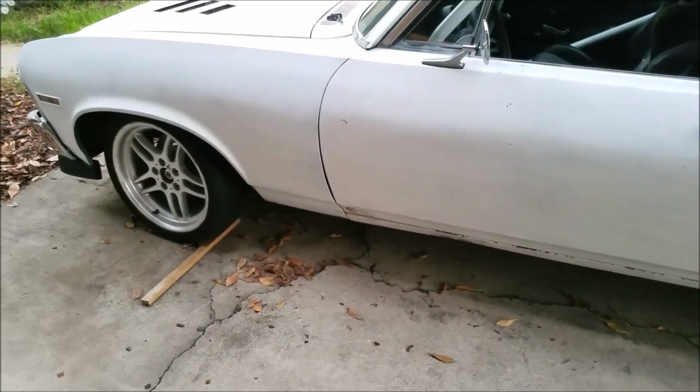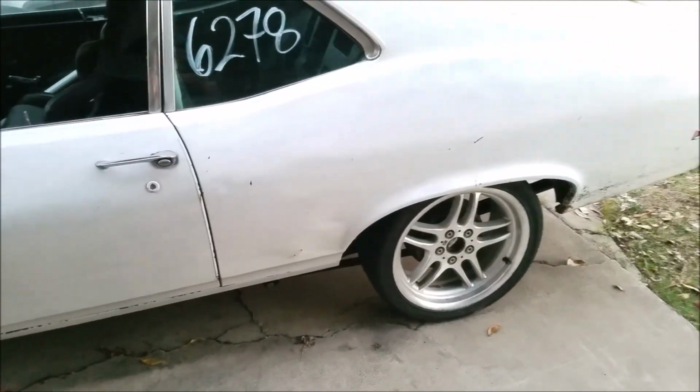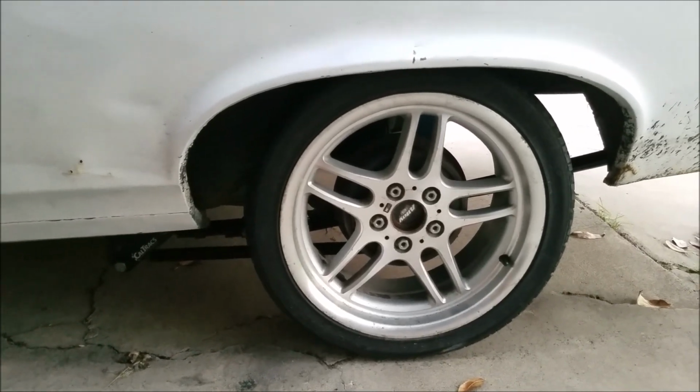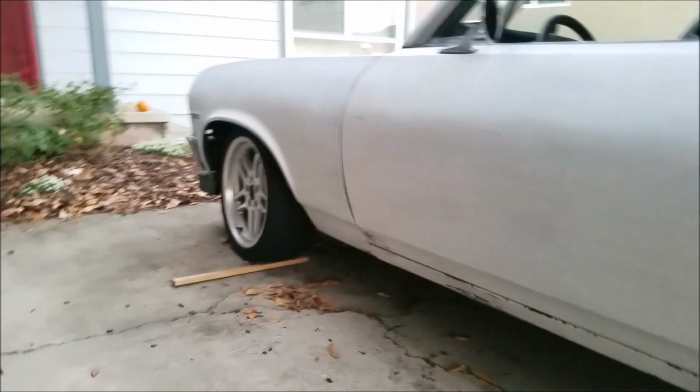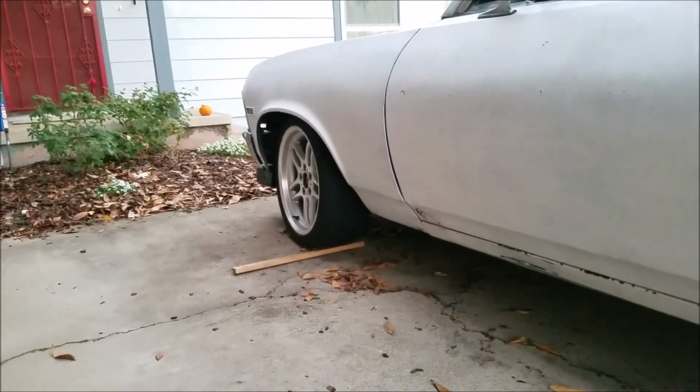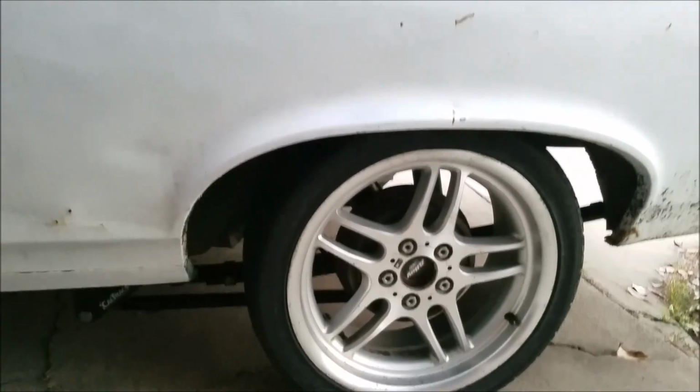And the final thing that I did to the car this year, if you've already noticed thus far, I have new wheels. These are BMW E38, also known as 7 Series wheels, from the late 90s, early 2000s. And I just needed the one spacer in the front, but they're the same bolt pattern. And honestly, they fit great. They're 18 by 8. I think the offsets were about a plus 15. And, you know, a 1-inch spacer up front.